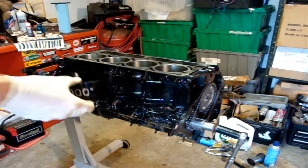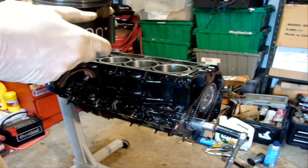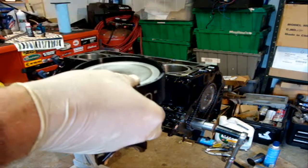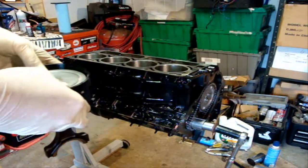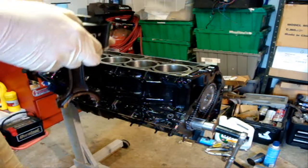I've already done the other side — I figured you'd be able to see easier this way. This thing is fantastic. Normally when you put a piston in, you grab the handle of a dead blow — like a sand-filled hammer — and give it a couple whacks and it snaps in. That's how I was doing it with the other ring compressor. With this thing I can just push it straight down; it's like there's no rings on it at all.